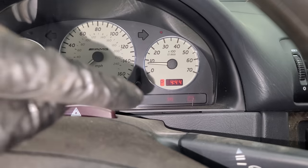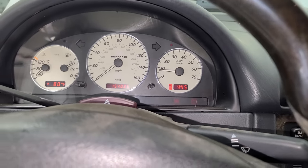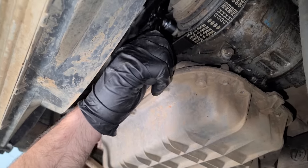All right, cool. That's super awesome, really excited, but you can see these really dim lights over there. One of them's a battery light. That means the alternator is not doing anything. With the transfer case job done, we have to figure out why we aren't charging. And this alternator has, I don't know, 160,000 miles, whatever this car has. I believe it's the original.